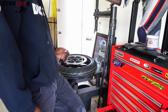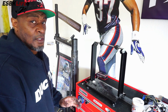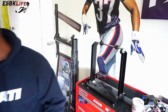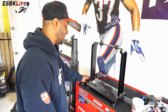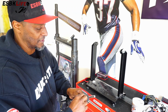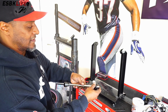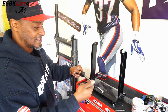So now what we need to do is we need to balance the wheel and tire assembly. All right, so what we're looking at over here is my manual wheel balancer. Oops, I forgot one thing. Forgot tape. So I picked this up. I think this one is from Harbor Freight. Not the greatest unit in the world, but it works out. So basically what we do is we take this rod, which is held in with an Allen key. Oops, wrong size. Here we go. So we take this Allen key, slide the one thing off, slide this through your wheel, put this back on, tighten it down.